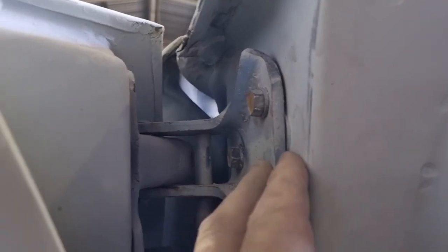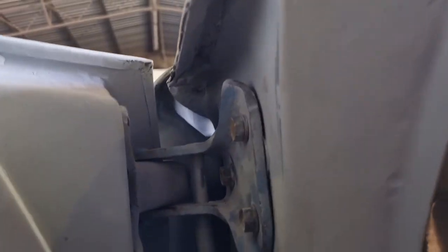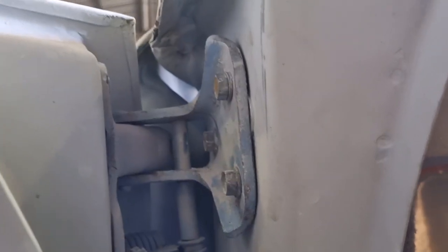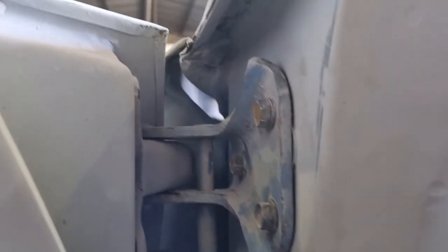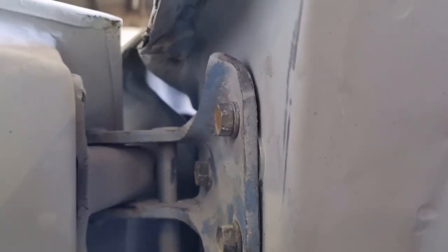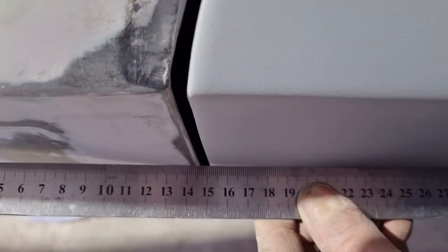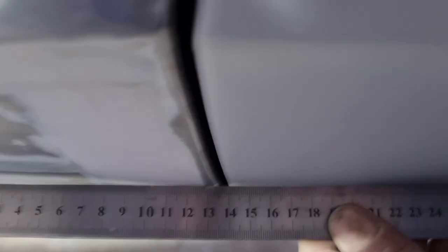This is going to be just temporary, whether I'm going to put those washers behind the bolts when I bolt it up, but I do actually have proper body shims back at the workshop, so we may just put them in it, or we might just put them washers back in it, because them three washers I've slipped in behind there have actually made it spot on. We'll see what we do there, but if you have a look down here, it's spot on. We don't have to do anything there. We just got to shake this guard and finish it off.